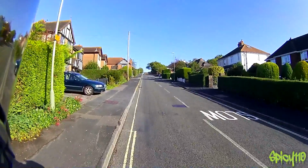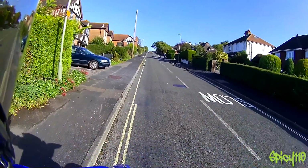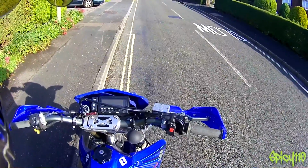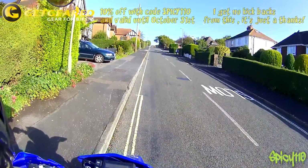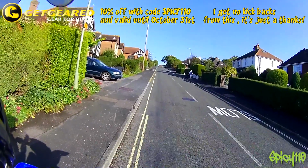Now, I'm going to do something that I don't advise you ever do, which is put the bike in neutral on a hill, because you will start rolling backwards! The other problem is, when you're on a hill and you're in neutral, if you pull the front brake, you're just going to drag the front wheel, because you've got no weight going onto it. You can brake with the rear brake, which will have the weight of you on it, but unfortunately then it wants to pivot the bike over backwards if you're going fast enough.